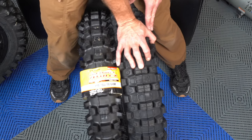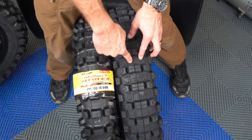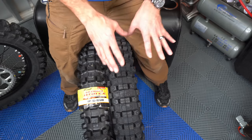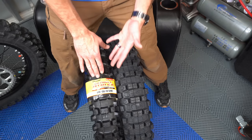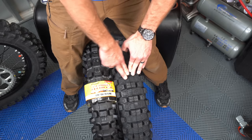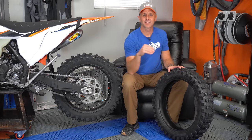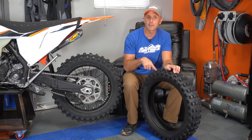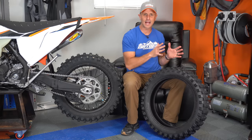That means this tire gets exceptional traction, but I can use it more confidently with tubeless — it's got more flat resistance and it holds plugs better. So this is just a little bit more of a durable, go-nasty-places tire. The Dunlop AT81 EX is awesome, but flats can be an issue. Whereas flats are a lot less likely to happen with this tire because it's got a lot more material in the crown. So the Dunlop is a great comparison to the 220 Ride tire, but this tire offers significant advantages — it holds a plug better, it is a stiffer carcass, it's going to have more flat resistance, and it's got that really soft compound. It's kind of in a class of its own.